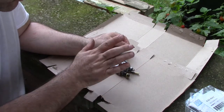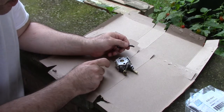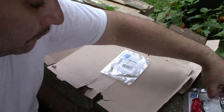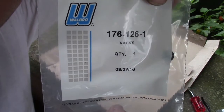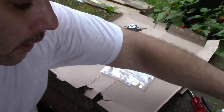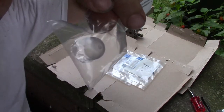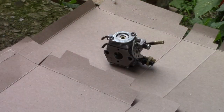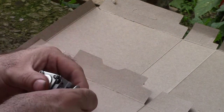I've already had the carburetor apart and cleaned it. I have the repair kit. You're going to want to replace the primer — this little guy here is the rubber check valve that ethanol affects, and that's the primer bulb. I unfortunately don't have a number for the primer bulb. I'm going to try and keep everything in the frame here and kind of show you how I work on these little guys.